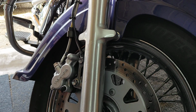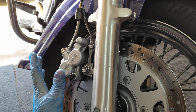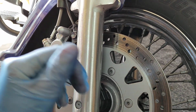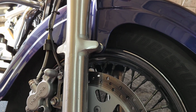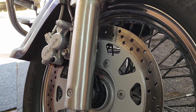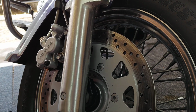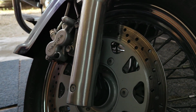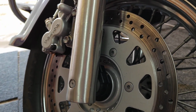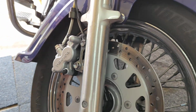Makes a massive difference. The only downside, if you can call it a downside, is that because this brake line and the brakes take out all the sponginess in the brake feel, as a result, you can really tell when the brake fluid has got old and needs changing. I felt like the brakes were getting quite spongy on my bike, and it had been about 3 years I think since I'd last done a brake fluid change. So I did the brake fluid and it really made them feel even better. So yeah, you just need to stay on top of your brake fluid changes if you're going to run this setup if you want optimal performance. Well worth doing, just amazing.